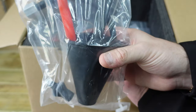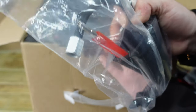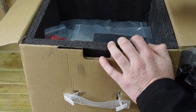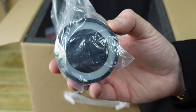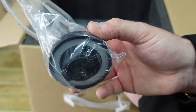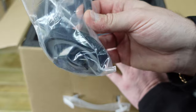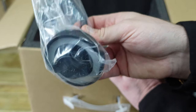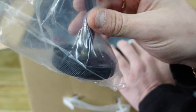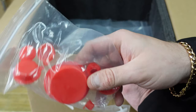You'll also get another section for intake piping, and a tool to remove any grommets on the car or anything else you might need to remove, which you then plug directly to the machine using the locking clamps. You also get an oil cap adapter — you pump it into the crankcase to find smoke via the crankcase. If you've got crankcase breathers or hoses that are brittle, you can put air into the crankcase through the engine to find where the leak is actually coming from. For instance, on a PCV system — which a lot of you end up getting on your M52 or your M57 — you can find out if your valve cover is leaking just from this. You lock off the oil cap, put this on, and direct smoke straight in there.